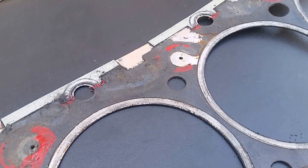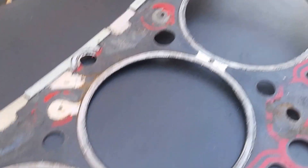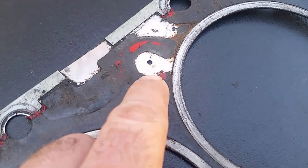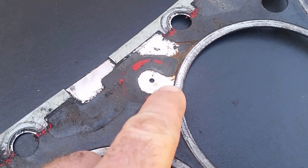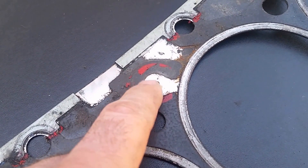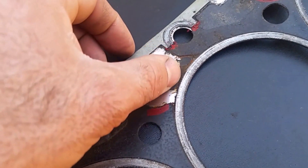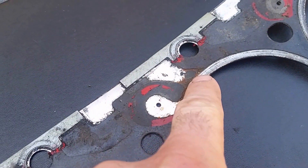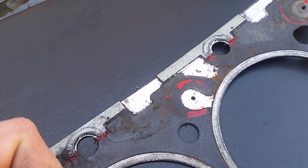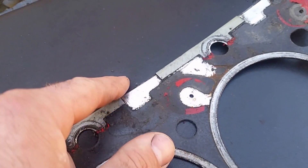I've shown you the head and the block, and now I wanted to show you the head gasket. This is number five cylinder and there's number six. I've talked to a lot of machinists and big diesel guys, and so far no real answers as to what caused this - it just ate the material out. This is the head side of the gasket. On the head side, it just ate the material out. It ran right along the fire ring there and just kept eating until it got up to the edge of the head gasket. And that's where, at the beginning of this video, you saw it leaking out - it was just dribbling over the side.